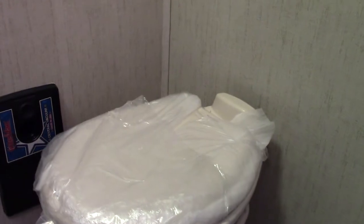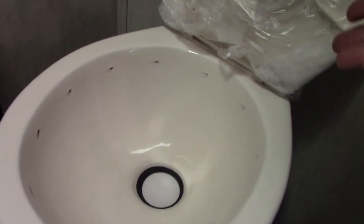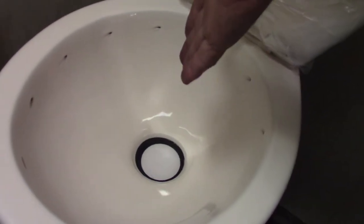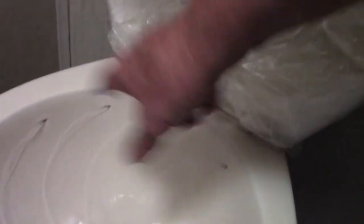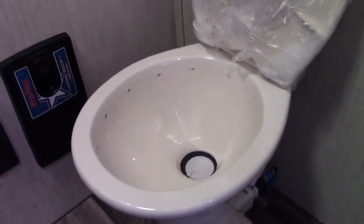The toilets — you have to remember that you can't use them dry and you've got to have chemicals. Same for every RV toilet: when you've got a dry black tank, when you first pull to the campsite, you put your chemical right in there, whichever brand you use. Step on the pedal and water will come swirling out. Put about a gallon or so of water in the tank — it doesn't have to be exact — but you have to have some water in there with chemical before you start using it. You have to do it that way, otherwise you'll regret it. Trust me.